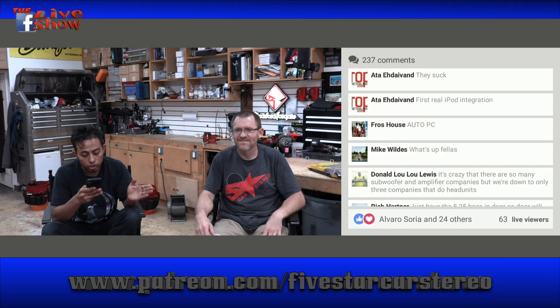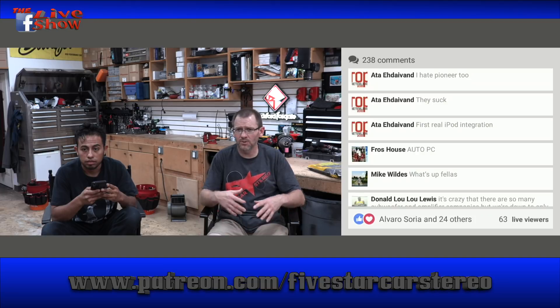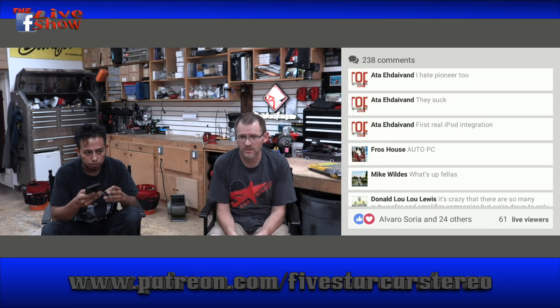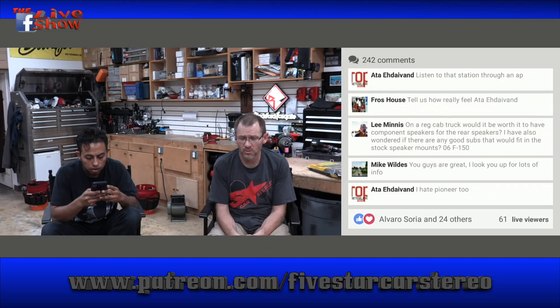Jeff Brown asks: is there a good filter for noise on the AM band for a Kenwood stereo? No alternator noise as far as he can tell — it's a constant whine. An AM receiver is basically a noise finder. I have no idea what you could use to reduce that noise. AM is what you'd use to find noise in a car. Your car apparently has something very noisy — could be a bad chip on a computer in your dash, the alternator, a spark plug wire, or a Class D amplifier somewhere in the car.